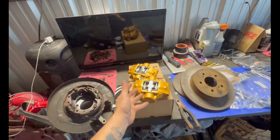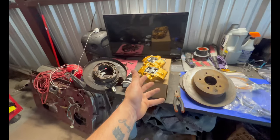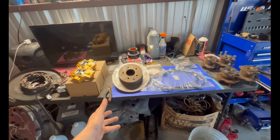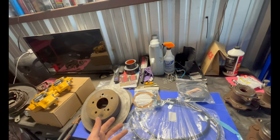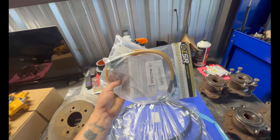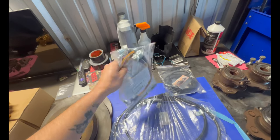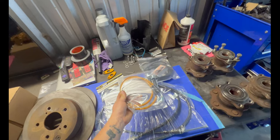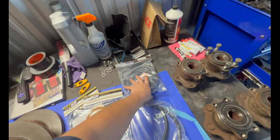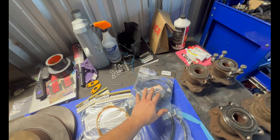So you'll get everything, brakes, calipers, front calipers for about $700. What else you're gonna need, depending on if you're running e-brakes, brake lines, you will need a conversion brake line kit, which is right here, Z32 to S14/S13. And I went a little extra. I got the Gktech brake line delete.